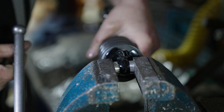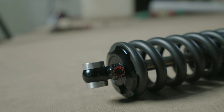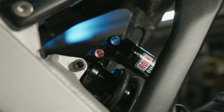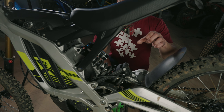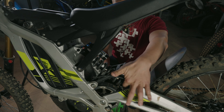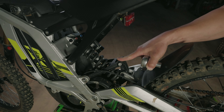If you can't make your own hardware you can order them online, but because I live in Korea there aren't any available so I have to make my own. If you're having trouble taking out your rear shock — which is pretty simple — I'll show you how to do it. To take off the shock you have to remove the bolt off this, this, and this, and of course the shock bolt, so that's a total of four bolts.